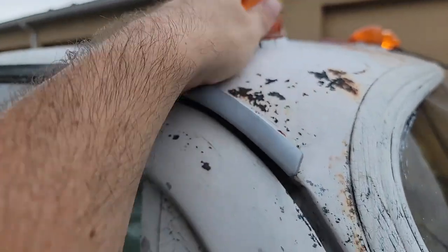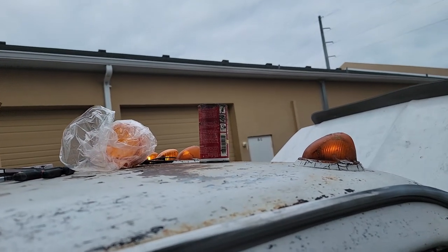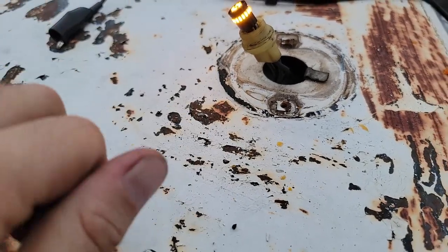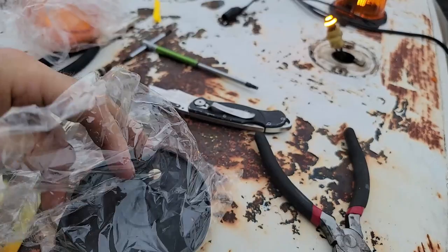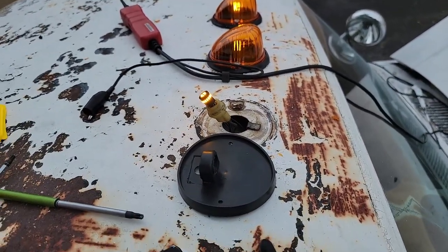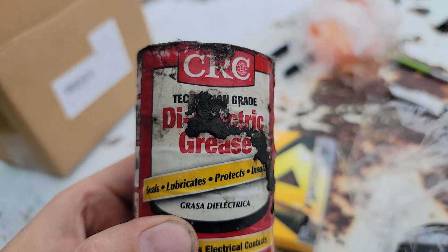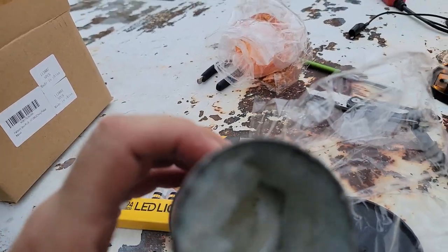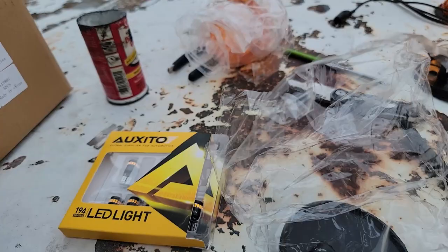Look at how old these things are. I just barely touched one and it fell apart. The factory screwed-in nut — I clean this off with a razor and then put the new one on. Those look like that, and then the new top. Pretty simple. And dielectric grease — this is one of those aerosol ones. The aerosol wears out and you throw it away, but if you actually pop the top off, there's tons of dielectric in there. I still coat the terminals. I clean the spot where the ground goes, put some on the ground piece too — so if water ever gets in there it'll keep it from corroding. Just good insurance.